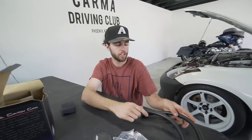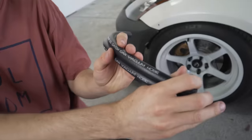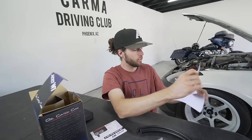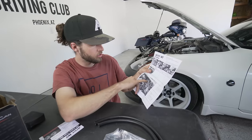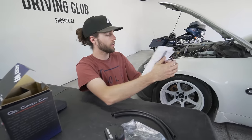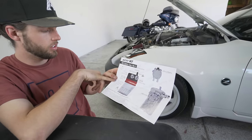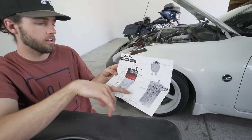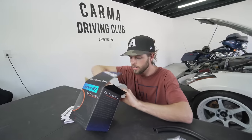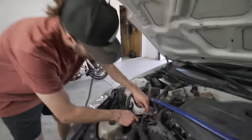We have our hose, which is super clutch. It's even labeled 'oil catch can vacuum hose.' We have our directions showing exactly where it goes — really easy. This is a breakdown of what's in it: oil dipstick, applied tape seal, inlet, remove base to empty catch can by unscrewing the base, and an internal filter. We also have our hose clamps and all the other hardware. We're going to use a 10-millimeter to take off this bracket — just the two bolts on the side.